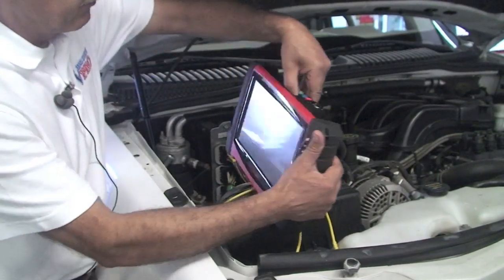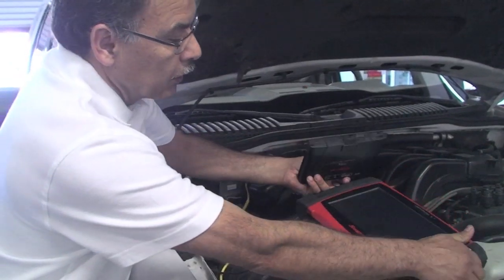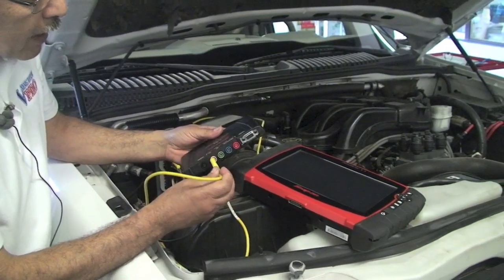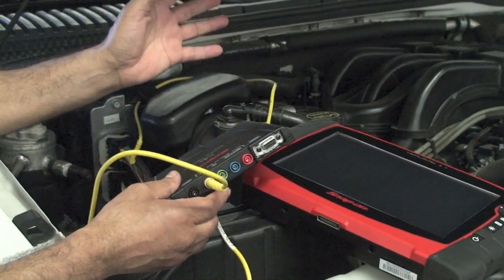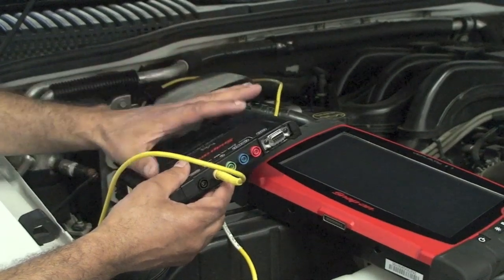The Verus Pro has a very interesting system we're going to use. We're going to disconnect the portion where you hook up the solenoid wiring harness, and we're going to back-probe the transmission control module to it. We've already hooked up the pressure transducers, so we're going to connect all this to the scope meter, and then we'll see it live.